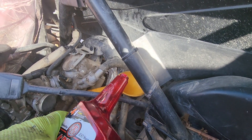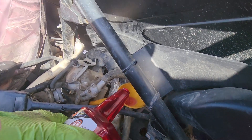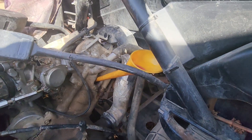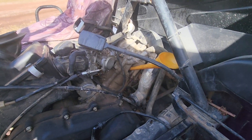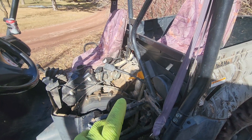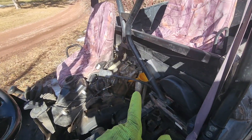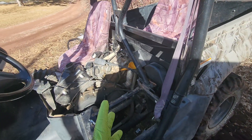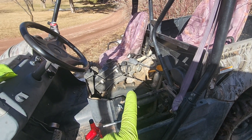We'll give it a little more to make sure it's full and we will let this sit overnight - probably for several nights actually. Then we'll go ahead and change the oil, as this is going to wind up in the crankcase and in the engine oil. After a couple times doing that, we'll stick the bore scope down in there again and see if this might free up those rings, clean out some of that oil residue, and get this thing to quit burning quite as much oil.